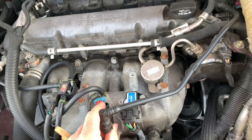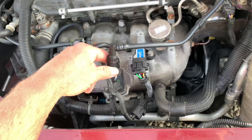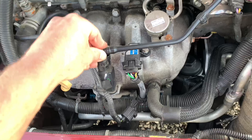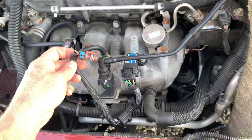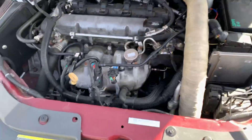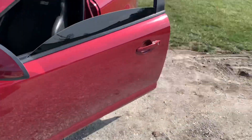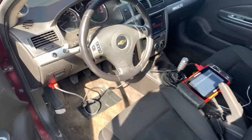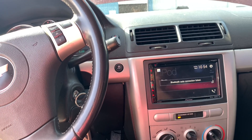You can hear the fuel tank pressure change and the pitch of the engine change. So I believe it is going to take a purge valve solenoid, and that should clear up the hard to start after refueling. Since it's unplugged, the PCM no longer has control over it — it's using engine vacuum, sucking the fuel tank pressure, changing the value, and that's why we're getting both codes. We're going to replace that purge valve and recheck.